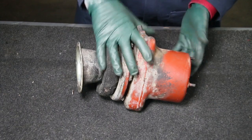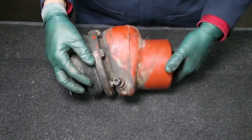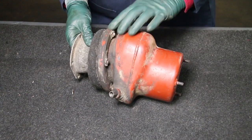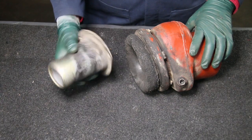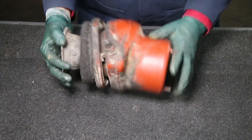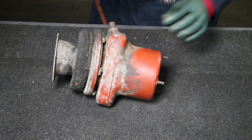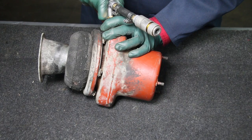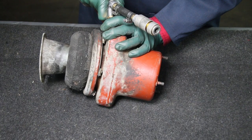This whole assembly is composed of an air tank that bolts to the upper control arm. You can see the inlet here for the compressed air from the engine-driven compressor. It's split right here — you can see the screws where the two halves meet — and then there's a lower steel tower that bolts to the lower control arm and sits up into that air bag. I'll apply a light amount of compressed air so you can see what happens. You can see it won't hold air — see it leaking back. All four were leaking like this, but at least this gives you an idea of how it works.